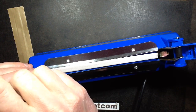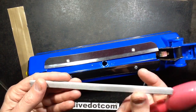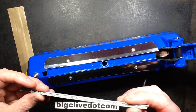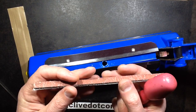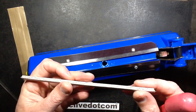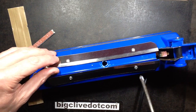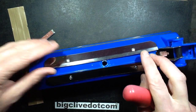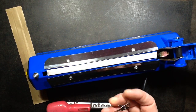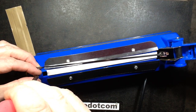Underneath the element is more of that Teflon-type tape, and then what looks like a bit of tile — almost like linoleum. Hopefully not asbestos, but you know what China's like. It's slightly flexible, looks like a strip of linoleum. You can see this is a plastic case and that's where they've cut the welding sprue off — the screws are just self-tapped. When putting the replacement element in, you basically sit this bit in and then hook the element over at the back.